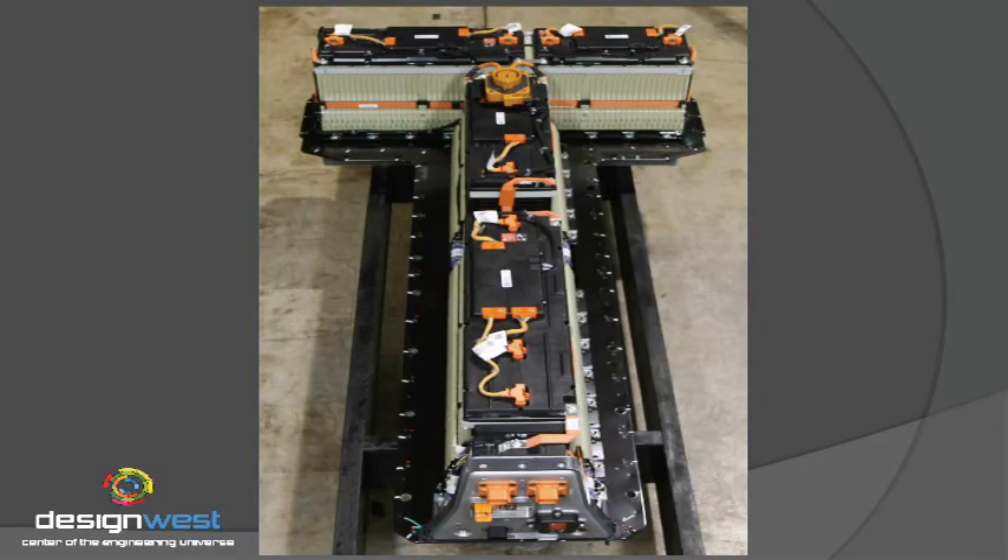Before getting into the electronics and control system, I'd like to frame it by talking about how much energy this battery can hold, since the goal of the car is to reduce gas consumption and allow purely electric driving as much as possible. This battery pack weighs 435 pounds and is about 5.5 feet long. It will move the car about 35 miles — roughly the distance you can go on a gallon of gasoline, which weighs about 6 pounds. On a weight basis, gasoline is 72 times more efficient than this state-of-the-art lithium-ion battery pack. The wall for entry to a truly competitive electric vehicle is very difficult.